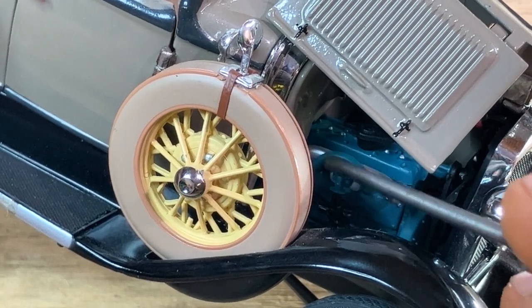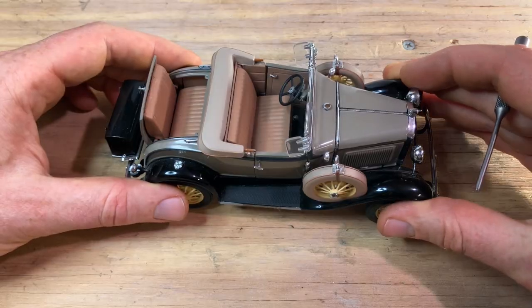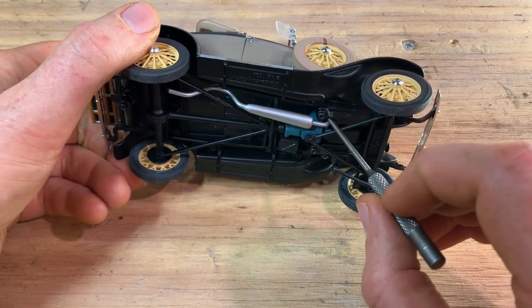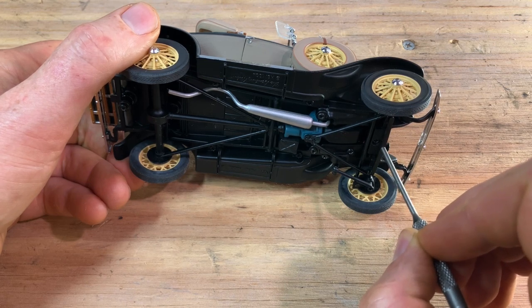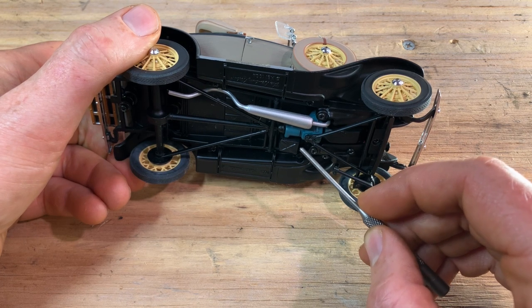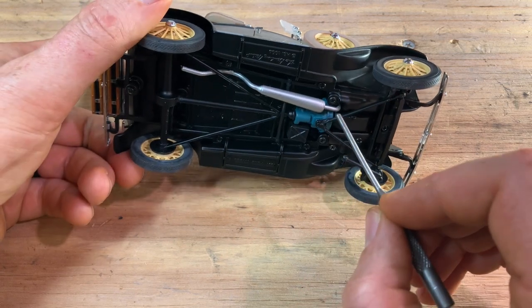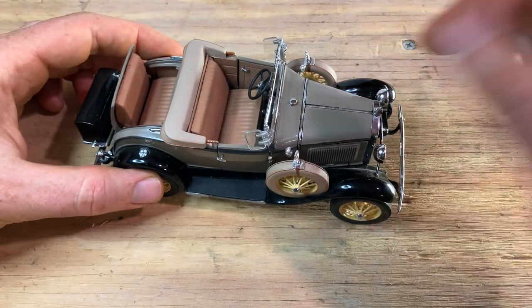On the other side of the engine, take out the fuel line, vacuum line, detach the distributor, and the spark plugs. Then go to the underside of the car. Detach the tailpipe from the manifold, take off the engine pans, release the front motor mount by taking off that bolt so it's free. Lastly, detach the radius rod which attaches right here underneath the flywheel housing, and disconnect the U-joint housing. Then disconnect the engine from the motor mounts and bring in your shop crane to lift the engine out. That is the one-minute version of engine removal.